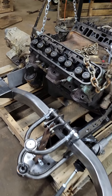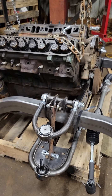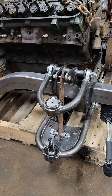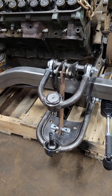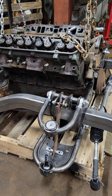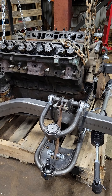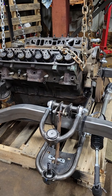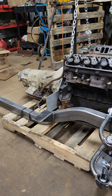With this setup here, you ain't going to mess up the alignment unless you bend something severely. Plus, I can get reproduction parts from Checkered Racing in case something does go bad — it'll be a lot easier than having control arms I don't know what they fit or someone else's product. That was the main reason: the alignment issue, and a factory bolt-in subframe versus a universal subframe.